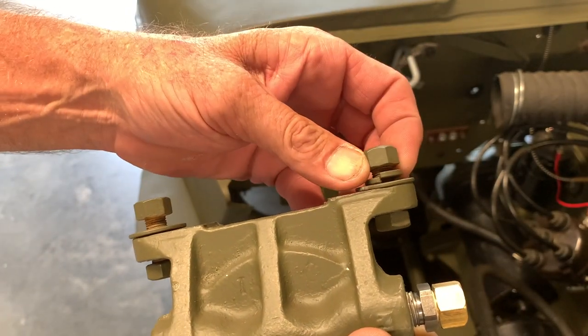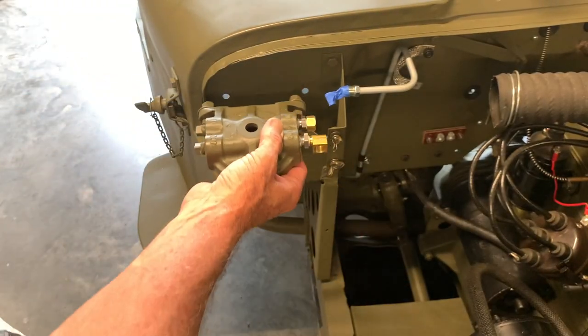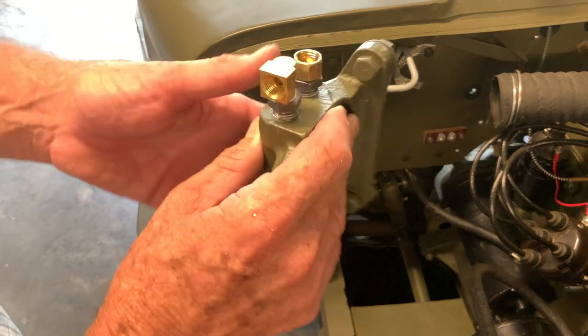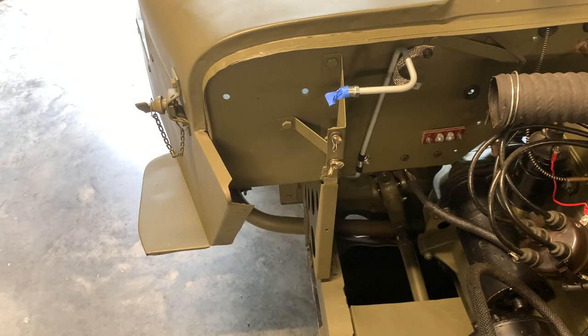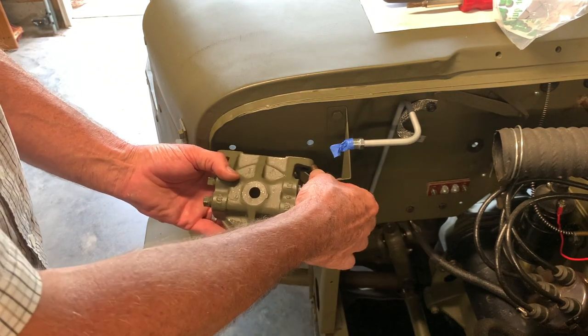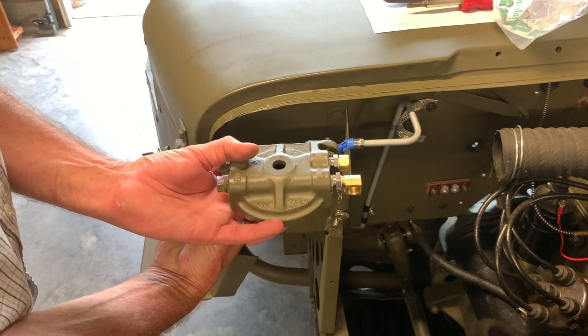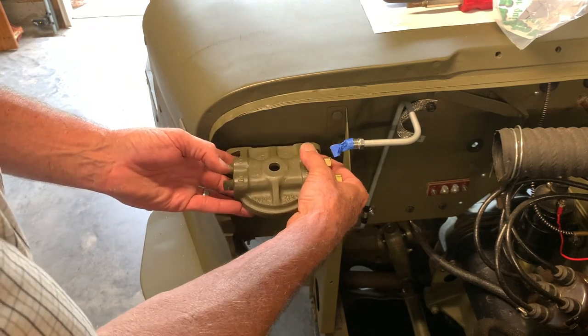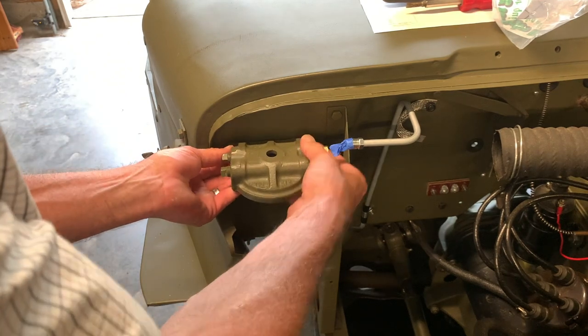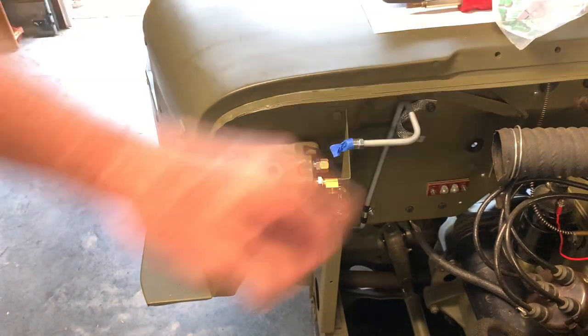Looking at the hardware on the back side: there's a flat washer, a lock washer, and a nut. The bolt size is 3/8-24 by 1 inch, and that's going to be installed just like that. The holes will go through the tub to the back side and we'll be fastening from inside the glove box. Remove the nut, lock washer, and flat washer, then slide the bolt from the outside through the back of the bracket and into the hole on the firewall of the tub. That'll hold it while you reach inside and install the other fasteners from the glove box.